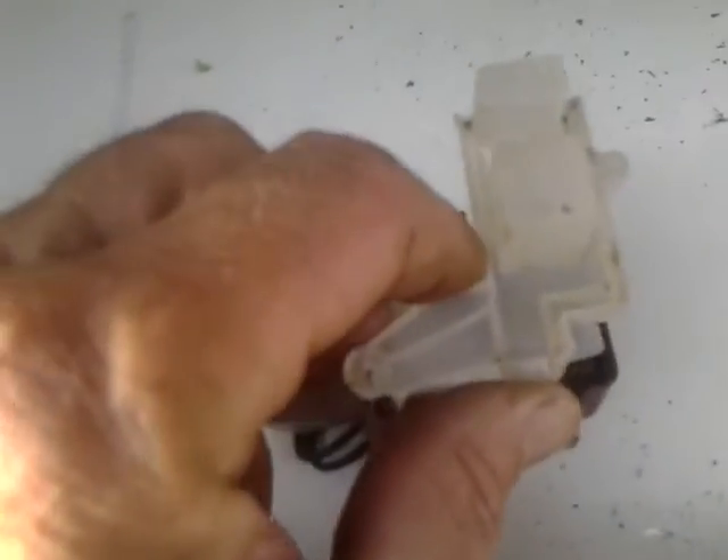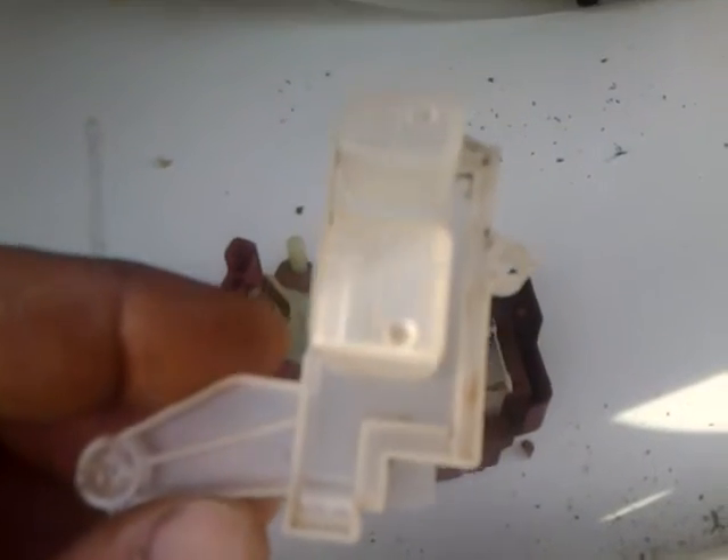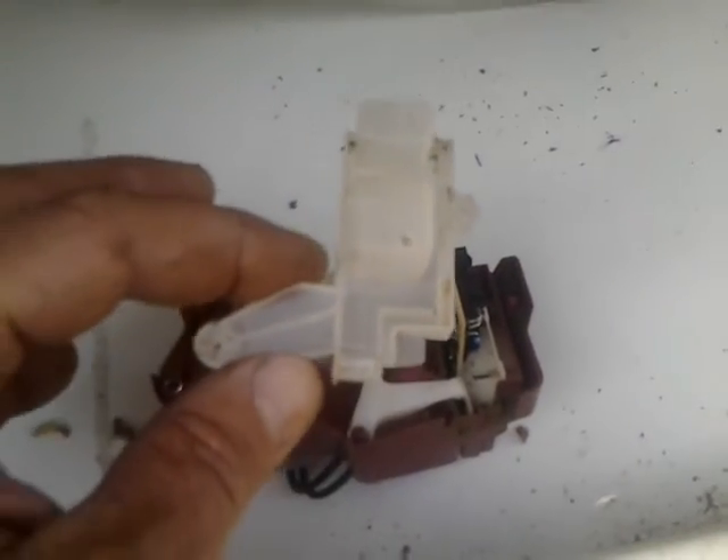I have another shifter, but I was just going to put it all back together and see if this works — just cleaning this. Between these two towers here, it was all mud, so the optical sensor couldn't go from the fat one to the skinny post. I'm guessing that might have been the problem. I'm going to put it all back together and see if the washer is working fine again. Stay tuned. Thanks for watching. Bye.